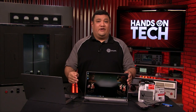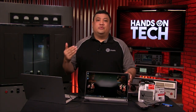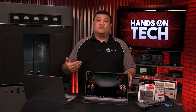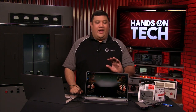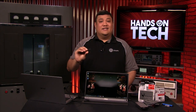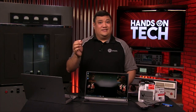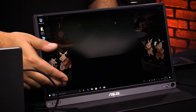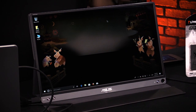It has a single USB-C port for power and connectivity, but the ZenScreen isn't just a USB monitor — it's a dual-mode display device. If you have a USB-C port with DisplayPort alternate mode, the ZenScreen acts as a pure, no-latency DisplayPort monitor. If your laptop doesn't support alternate mode, it acts as a DisplayLink USB monitor, connecting through a USB-A port or Thunderbolt 3. ASUS includes all the gear you need: the monitor cover that doubles as a stand, a USB-C cable, and an adapter to turn USB-C back into USB-A. You have access to advanced display settings through ASUS's display widget, and the screen supports auto-rotation, though that's a feature I almost never use.